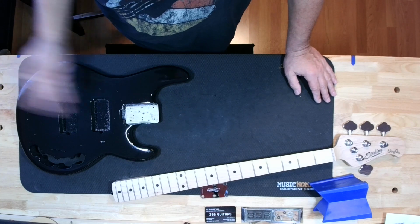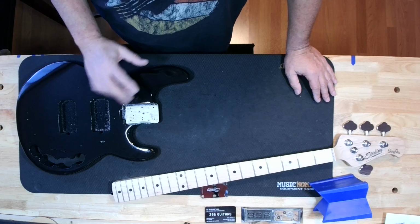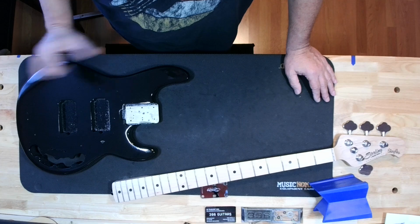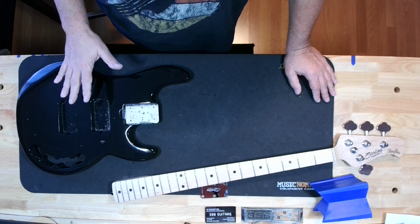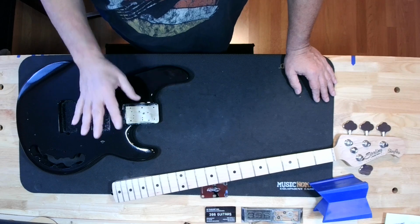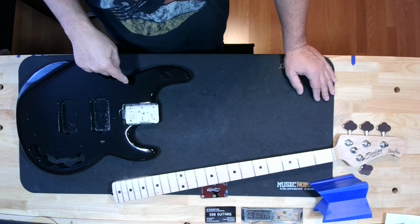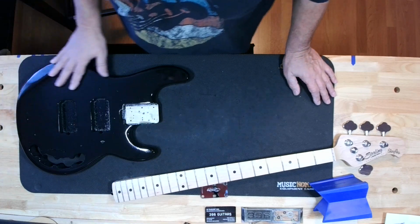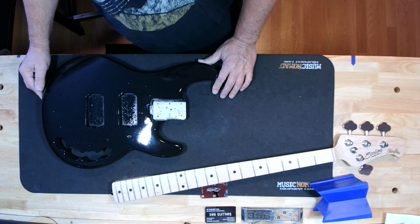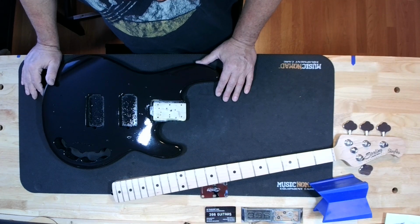And of course, day by day, I would put a can on it, which is about 3 coats: spray, half an hour, let it flash, spray another coat, half an hour, let it flash, dry, spray another coat. And by that time, that can was empty. Then I let it cure for a couple of days. Then I went with a second can of black, okay? Did that same process all over again. And then let it cure for a week.